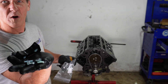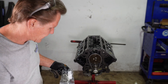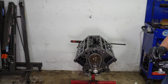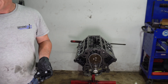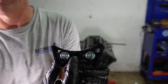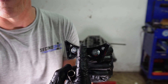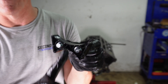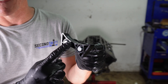It is just this little brick. It comes with new bolts — the bolts have little washers with rubber O-rings, precisely spaced. They are little M8 bolts, so we torque this down to the same 18 foot-pounds. These dampers are cool because if you look at them in the center, they have a little arrow. It's not difficult to eyeball the middle for lining up your dot-to-dot, but with this damper on there's an arrow that points dead nuts to the center — a nice little confirmation that your dots are lined up.